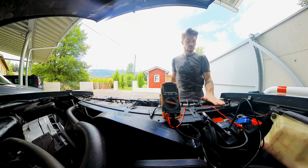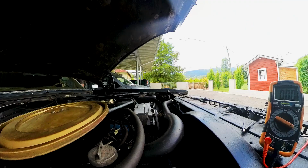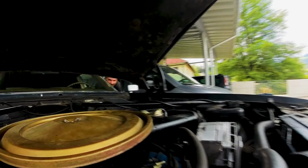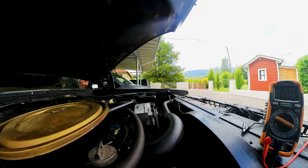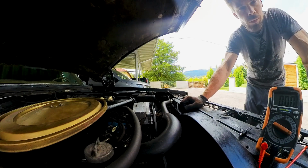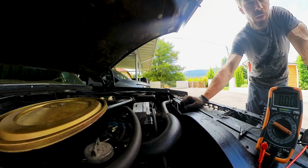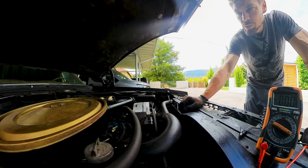The starter is bolted in all the way, everything's connected. Now let's hope that at least my parasitic drain is where it was the last time before I unbolted my starter. Door trim button in, main switch on. Yay, it got worse. Oh. Maybe closing the trunk helps. Alright, door trim button in, main switch on. Maybe it's really just this one thick positive wire going to my starter, which was a bit oxidized, bad connection. So I hope that this gets better with my new wires.